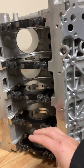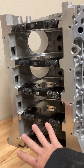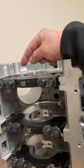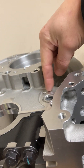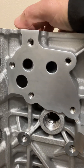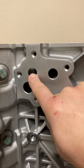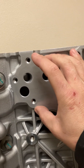You have the oil pump pickup here in the oil pan. The oil will get sucked into the pickup and go into the oil pump. The oil pump is going to pump it into the block. Now from here it's pressurized. You see that little bit of light there — it comes out through this port. This port is where your oil filter adapter will be if you have an oil cooler, whatever.